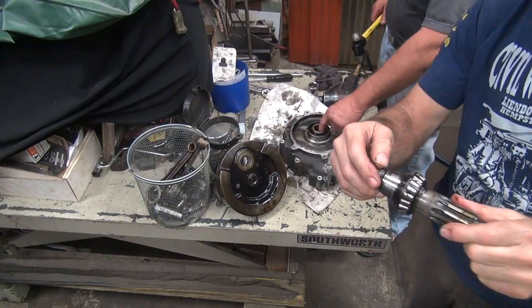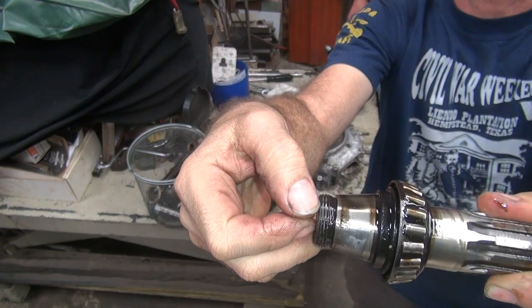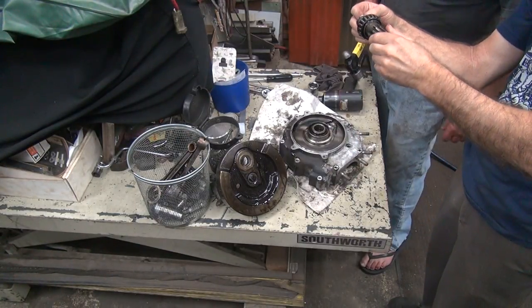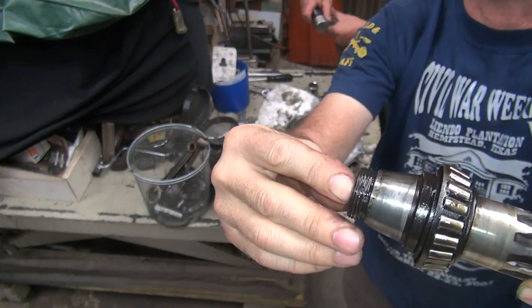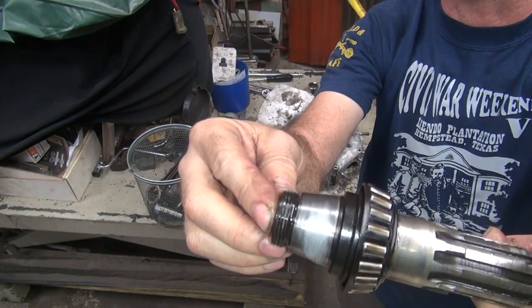I like hitting stuff with big hammers. Now see what he tore up on that nut right there. See how it screwed that thread up? Look at this one there, this one there, one over here. It has all kinds of them now because when that socket was spinning around at about 8 million RPM, it was bouncing around against the threads right here and screwing the shaft up.